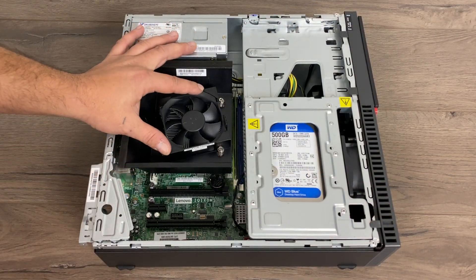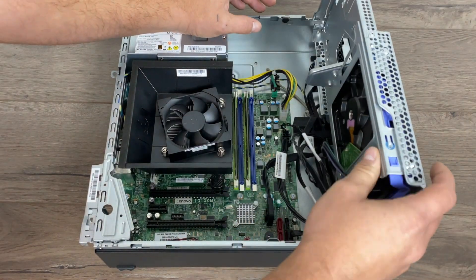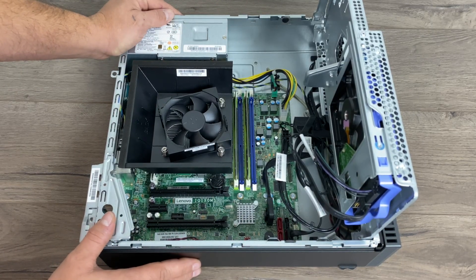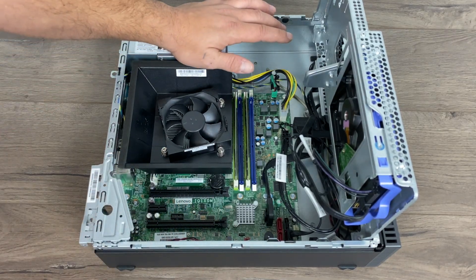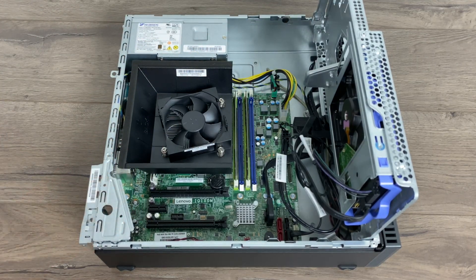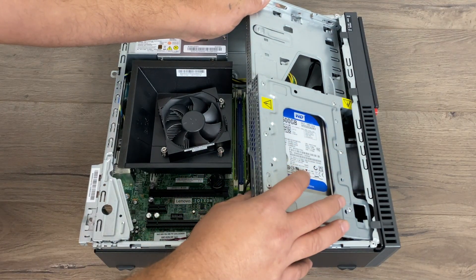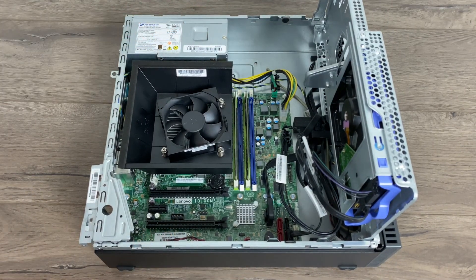In this video we're going to see how this machine performs with emulation. It has the i3-6100, 8GB of DDR4, and no hard drive was installed, but I had a 500GB Western Digital laying around and threw it in. I'd recommend using an SSD but I wanted to keep this as cheap as possible. I've been searching eBay and found the HP ProDesk 600 G2 with the i5-6500 for around $120 to $150. When buying these pre-built small form factor PCs, upgradability is scarce — you're going to stick with the CPU you have. Some have two RAM slots, some have four like this one. The highest GPU I'd go is a GT 1030, because of the power supply in these.